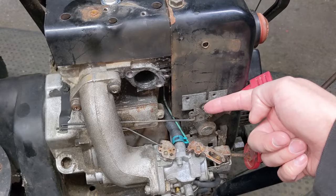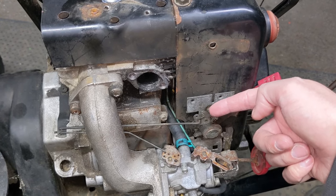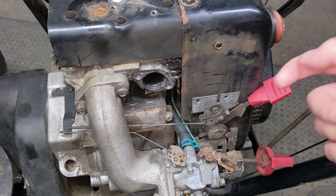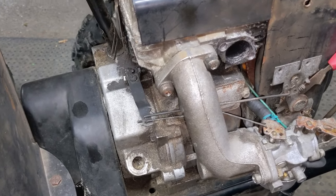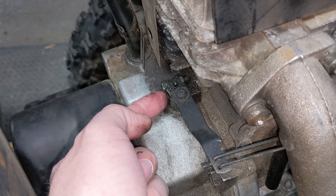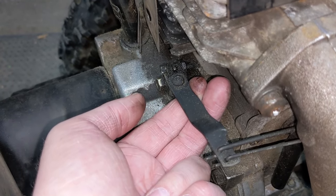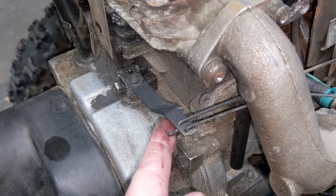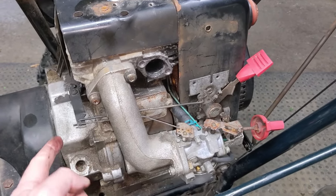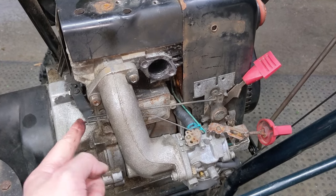For the next part, this is super simple. You want to make sure that this throttle bracket or lever is in the farthest forward position — so when the throttle's up, it has full tension on it. What we're going to do is come down here, pull this bracket and lever as far forward as possible, and tighten it up. Once tightened, it should look like that.